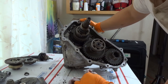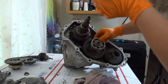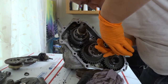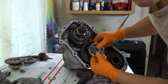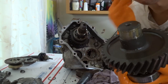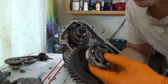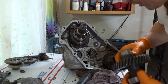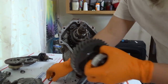The next step is to remove the front drive idler gear — this piece here. There's a snap ring right here, so we're going to pop that out. For the record, this is the snap ring for the idler gear. This is one whole piece — it only goes in one way. The bearings are pretty smooth, but it's probably good to replace them. To replace this bearing you actually have to get it pressed out. Down here is another bearing. We'll set that aside for now.